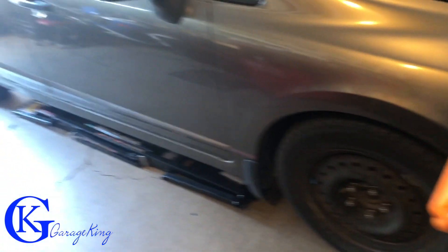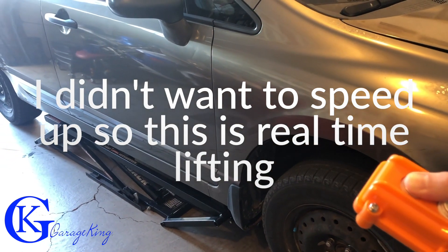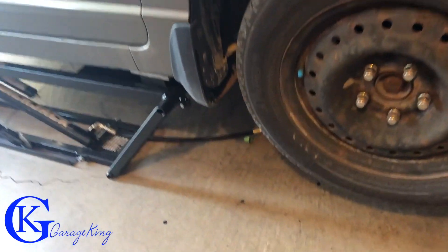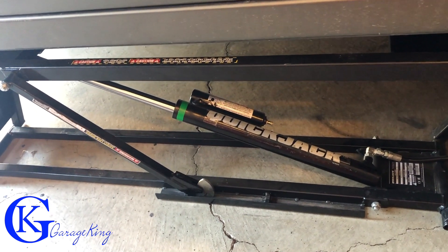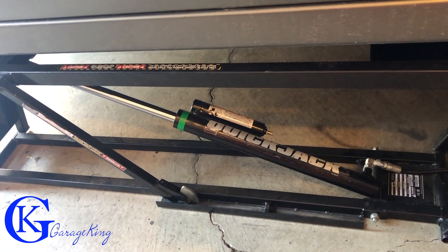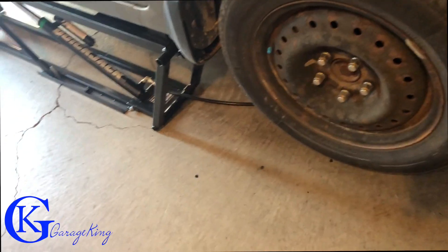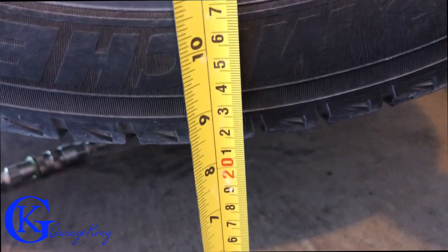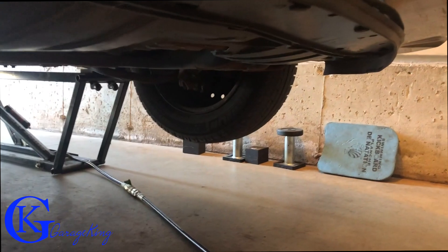You can see here's the button, so we're just going to press up. We have it set up on our Honda Civic right now. You can see how fast it lifts, and then once we get to the last lock we'll stop. It's fully on its locks there. So if we come in here and we want to see how much space — there's the tire, and we have about eight and a half inches of clearance below the tire. So once you take the tire off, you're going to have even more. And then if you look underneath the vehicle, you can see you actually have quite a bit of room.